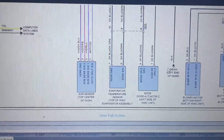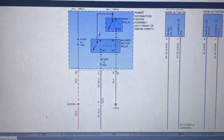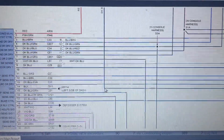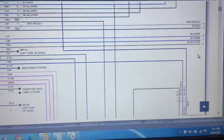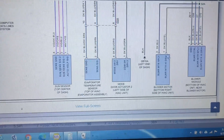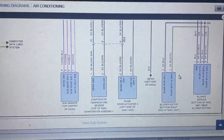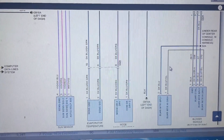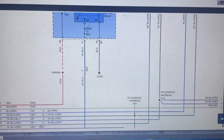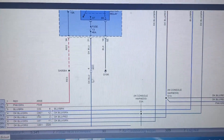The blower module then feeds the blower motor. So let's start from the beginning and verify that the relay is working and that we're actually getting voltage coming out. Then we can look at the module and verify that's working too. Even though the previous shop replaced both parts, we can't rely on that because it could be a cheap aftermarket part or a junkyard one. Let's go to the fuse box and verify the relay is actually pushing voltage out.